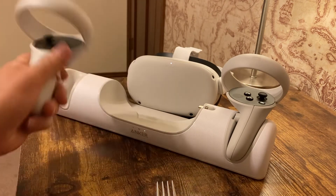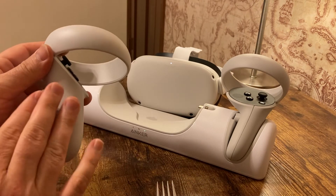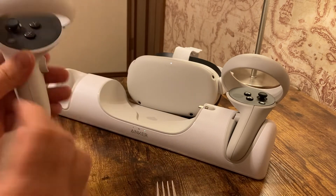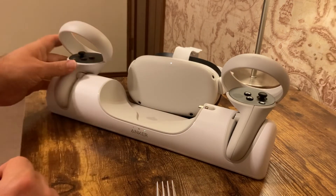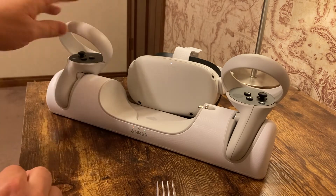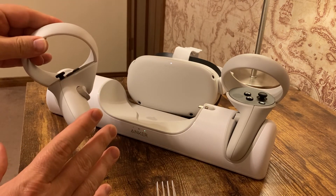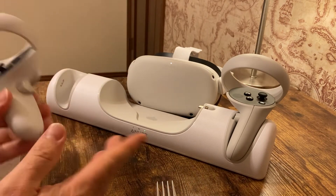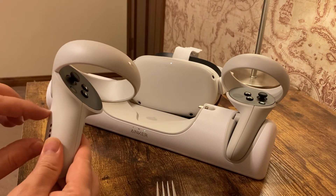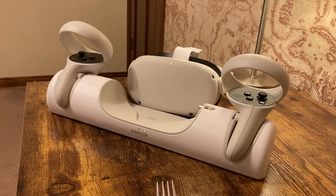One more warning: sometimes when you're messing around, those things don't rotate easily, but if you don't have the rotation just right with the battery and things get a little jostled, you might suddenly start seeing a blinking light and wonder what happened. If you're not at the end of the battery's life — these rechargeable batteries do have an end of life eventually — but if you just got the charger and you're getting this after some gameplay, just take the cover off, maneuver it a little bit, make sure the silver pads are lined up with the contact points for the cover, put it back in, and you are good to go.